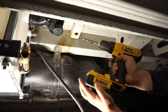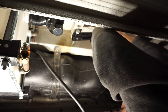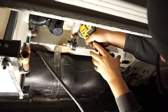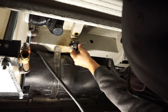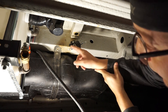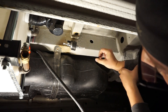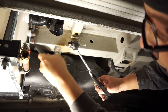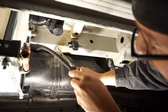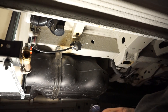After dealing with a dead battery, we prime it, install the rivnut, and mount the fuel pump. The pump needs to sit at a 15 to 30 degree angle with the inlet down, because there's a filter inside and flipping it the wrong way creates an air bubble. Once she's in place, we cut our hose down to size and reduce it to match the fuel pump inlet. Just like that, our fuel pump is hooked into the fuel tank.